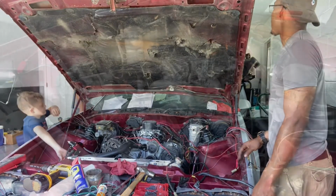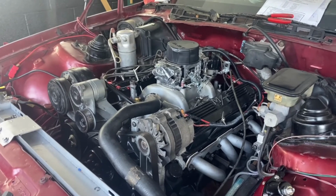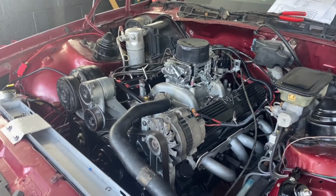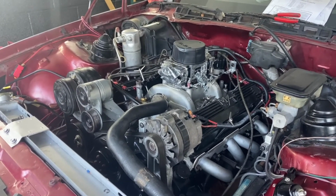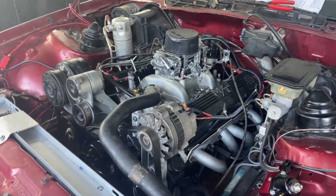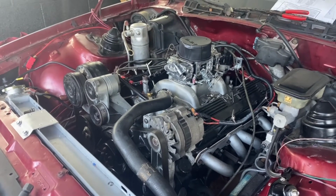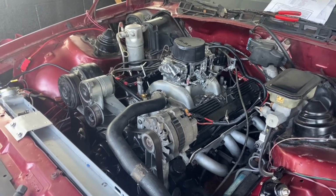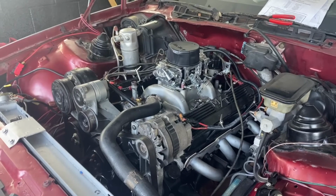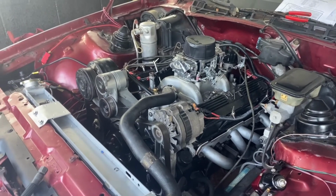Big painless wiring box. Okay, so we've got majority of the wiring complete. We relocated the wiring from the back of the alternator. It used to run from behind the alternator to the left to behind the compressor to the battery junction. So now we rerouted it so it runs back behind, adjacent to the valve cover, back behind to the firewall, around the other side of the valve cover. So we've got some more wiring to add to the system. We've got one more relay to wire in, but it's totally a no-brainer thing to do. We're going to get that part added in, and once that's added in, we can add the final wire loom to all the wiring and call this wiring under the hood complete.